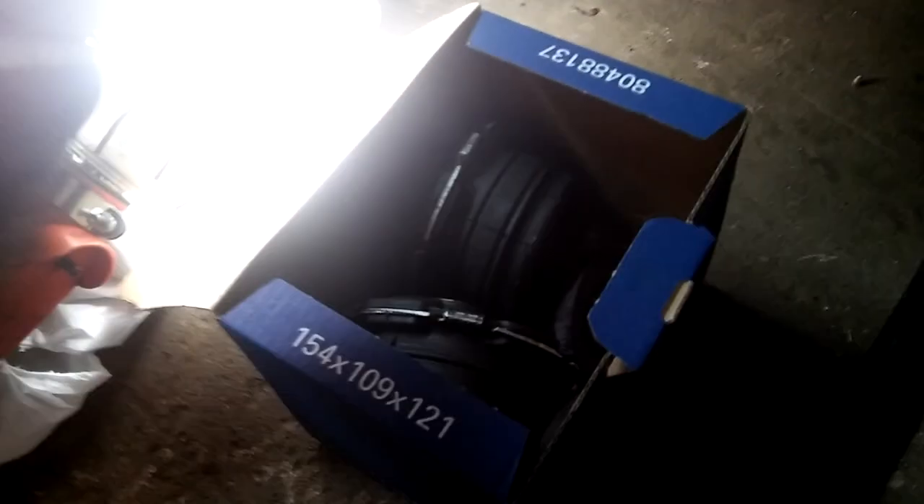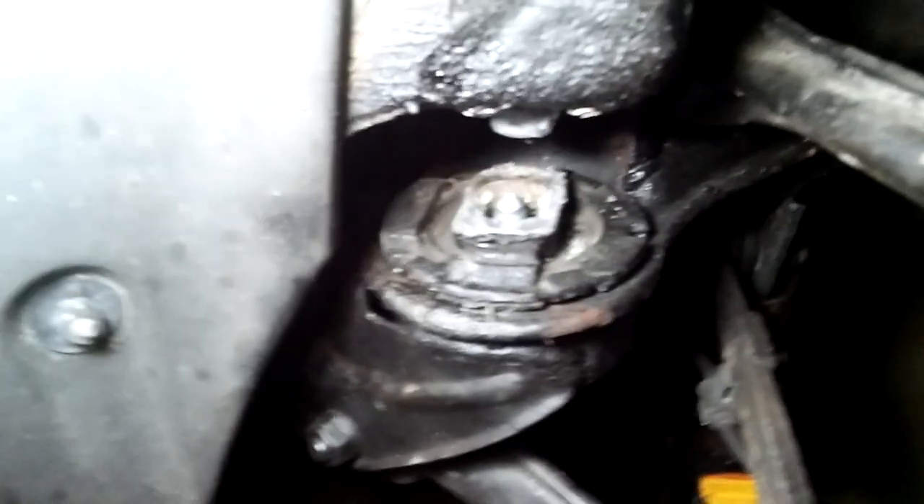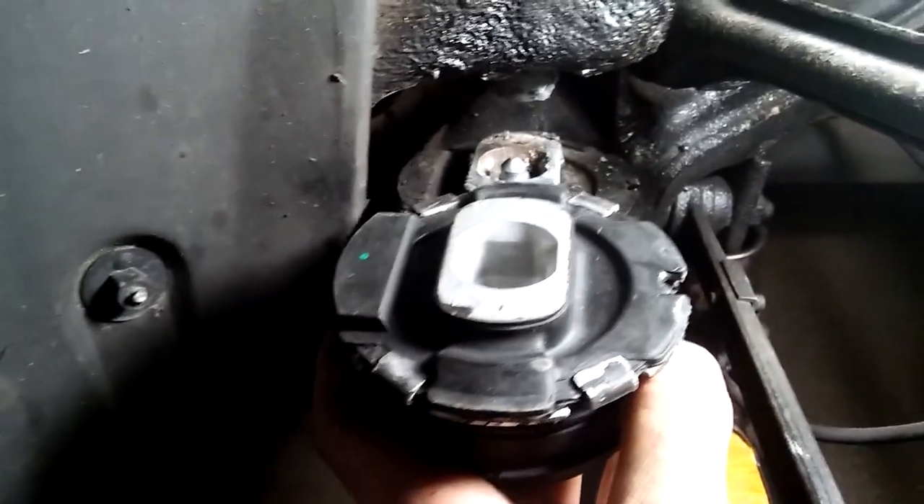These are my new bushings — this is for the front part, and as you can see it has new bolts and these two round pieces. Right now on the old bolt, these two pieces — the round piece and the bolt — are just stuck together, so you have to separate them. Also note how this thing is sitting, because you're going to have to press a new one in so it'll have to sit like this. I was able to separate the bolt and the plate — that plate can be pushed up and then the bolt just comes out.